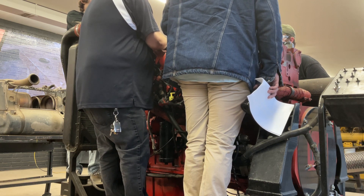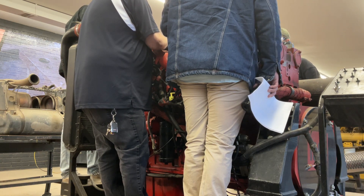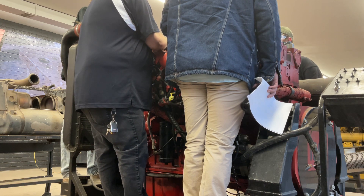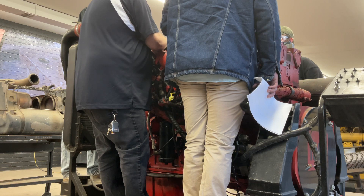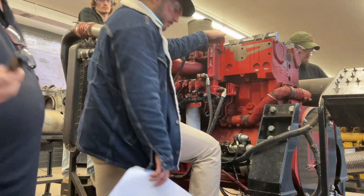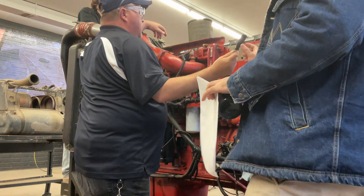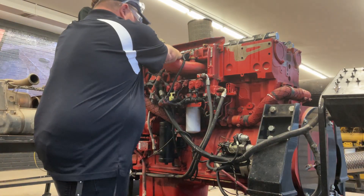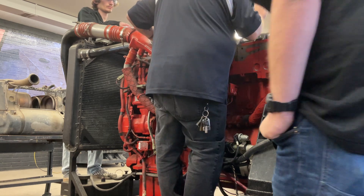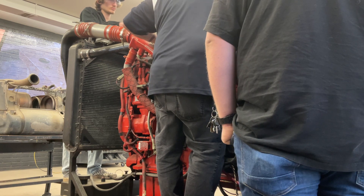So if the driver says he's got his brakes turned on but they're not working, the first thing I would do is plug in the electronic diagnostic tool to troubleshoot this without taking the valve cover off. The second thing I would do — just because it's fun — is take the valve cover off to do what we're about to do. So let's do this. Go over there on the other side, watch your fingers. I need someone to start it up. Once he starts it, right here on top of the solenoid there's a button — take that screwdriver and push that button down.